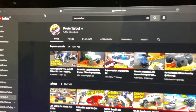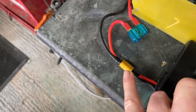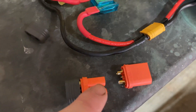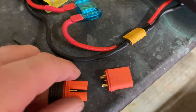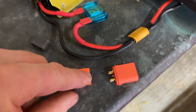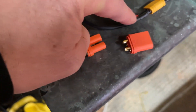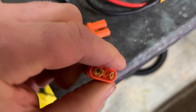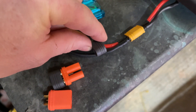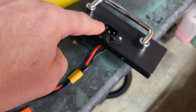My friend Kevin Talbot, who has a YouTube channel which I'll link in the description, has sent me a much better connector. That's the original connector and this is the one Kevin sent me — it can take a lot more power. Look at the size of the copper in it compared to the old one. All you have to do is cut the wires and re-solder them back in. The main thing is to make sure you put the sleeve over the wires first, because once it's finished that bit slides up and pops on.